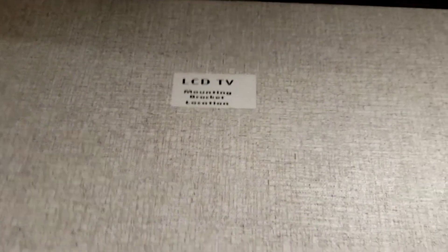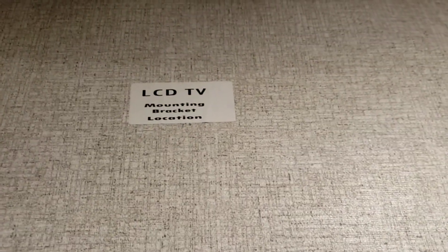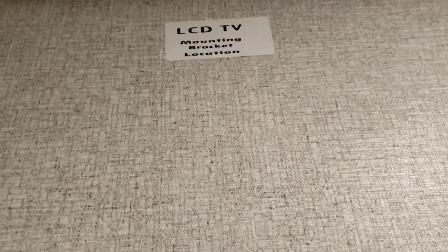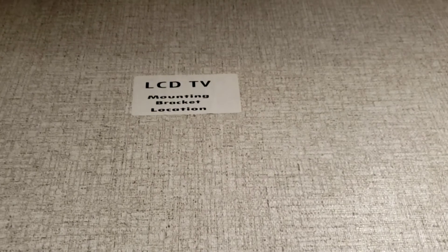Come on into the bedroom — ceiling lights just click on. Both work that way. You have an exit door so you can come in and out without going through the main area. You've got an outlet with dual USB ports on each side of the bed, plus a clicky reading light above the bed, plenty of storage, and a TV mount spot with a cable outlet. When buying a TV mount, double-check the screw length — standard mount screws are meant for 2x4s and are too long; if you screw through the exterior of the camper that's customer damage.